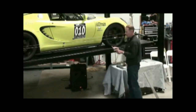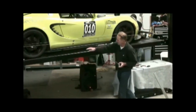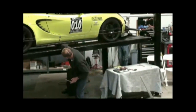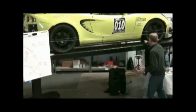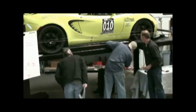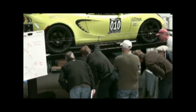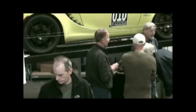Let me show people where to measure ride height on these cars. On the chassis — before the panel that everybody moves to change their oil — the chassis ends before that panel. So you measure the ride height right here at that point. You measure it here at the rear and here at the front. I use the point where the body mounts to the frame, both front and rear. You measure right to the end of the frame here — not the narrow stuff out at the edge. And because you want rake in the car, you want about a 5mm rake.